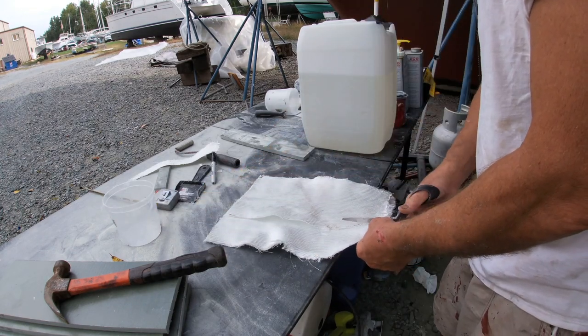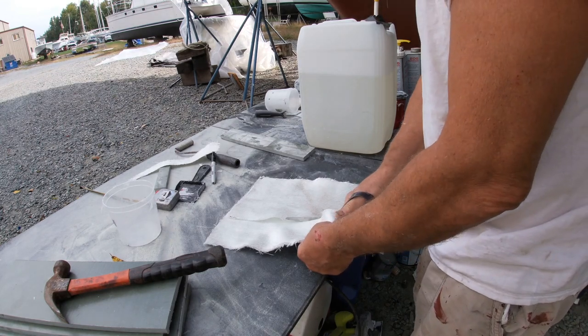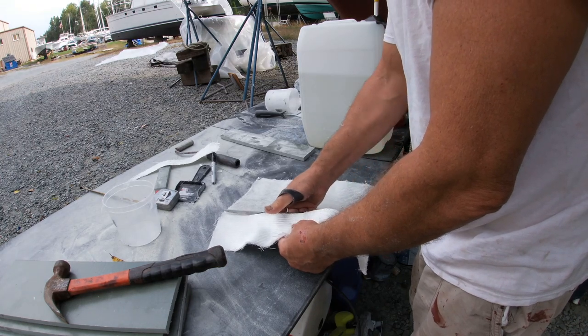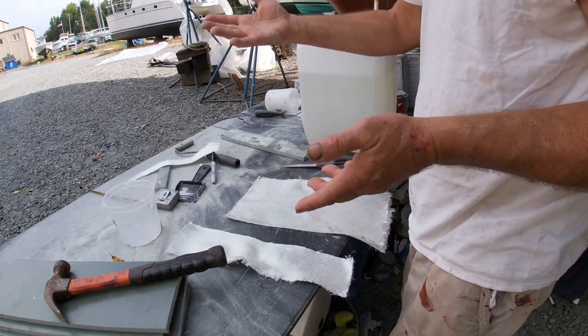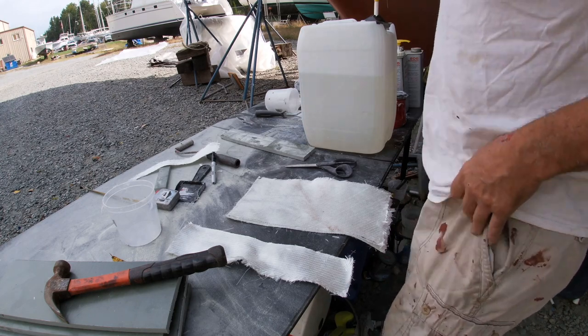That crack's not going to bother anything because it's going right to that strut, that little corner. It's all going to be ground. The other side directly under that crack is going to get ground down to like a 12-to-1 or an 8-to-1, so it's going to get all new fiberglass from the outside over the top of that crack.